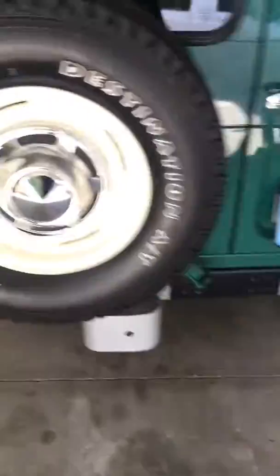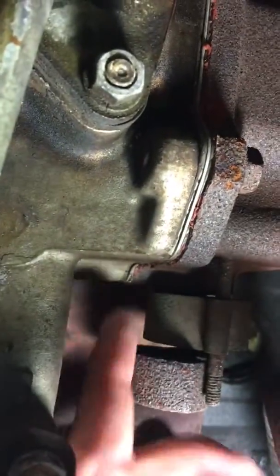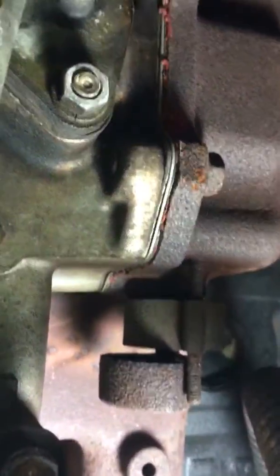Alright, turn the vacuum on, give the system a second or two to pressurize. I'm going to first feel around — it seems like I can almost hear something. I can feel something on this side of the exhaust manifold. I'm gonna get in this area. Here we go, we're gonna try it — got my soapy water, just simply dishwashing liquid and water. I'm gonna try to get a swathe and see what it is.